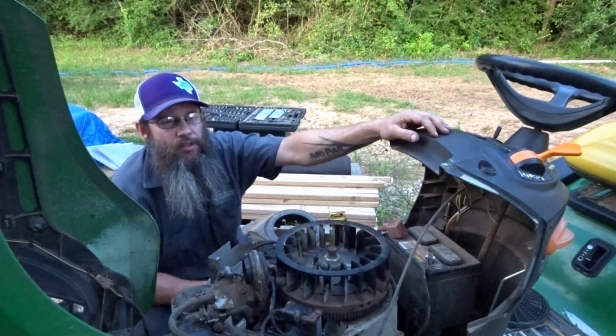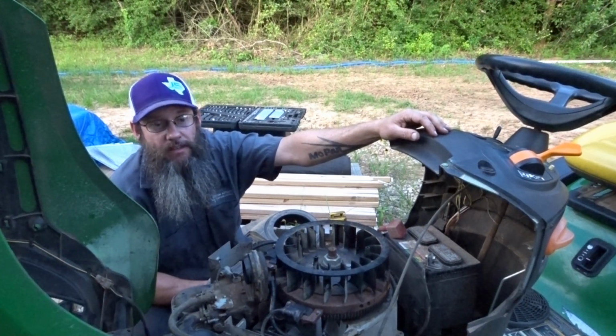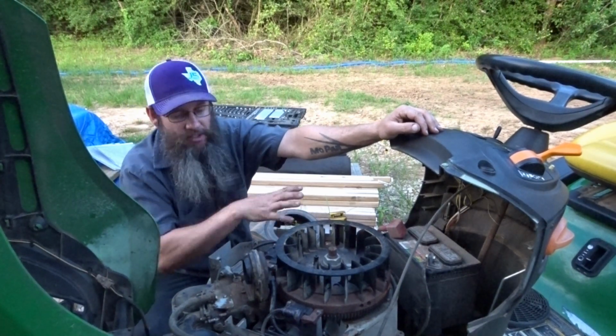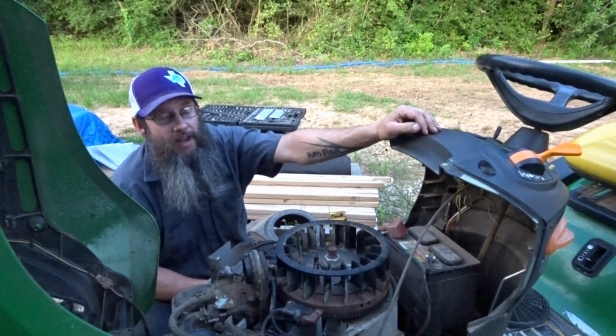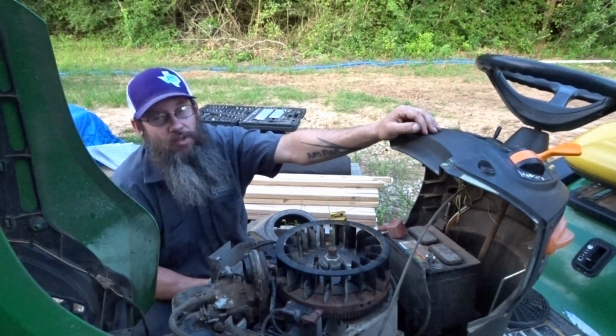And drain and fill the rear differential. They say don't do it. John Deere says that. The company that builds the hydrostat transmission actually has a service schedule on it. And when you tear it apart, it doesn't look anything like the one that they sell to John Deere, because where there's plugs, there's no longer plugs.